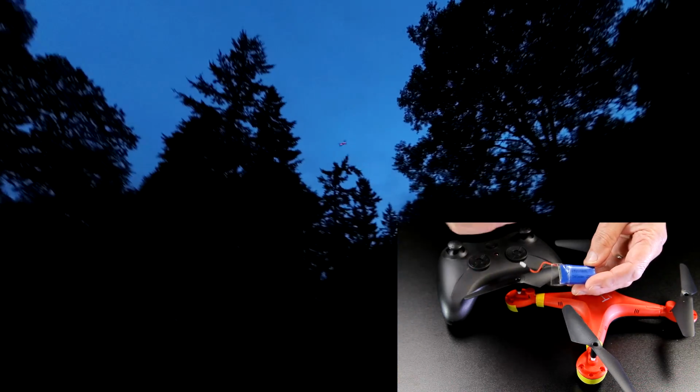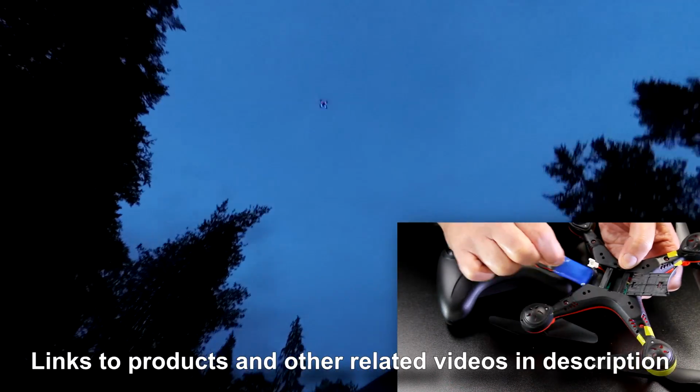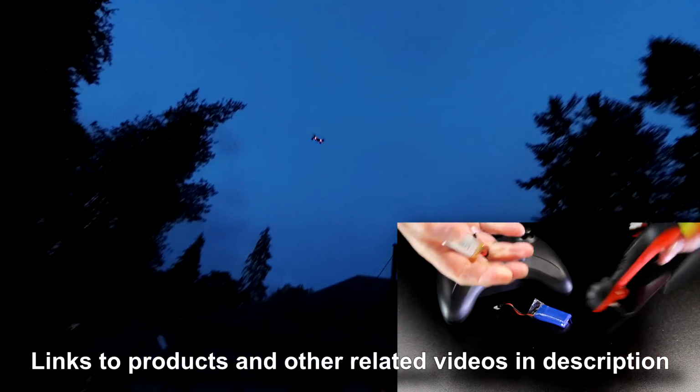So to me, I think that was brilliant. And you can buy other quads that these batteries will fit as well. Another little tip is just put a little bit of tape around there. I mean, sellotape, whatever you like, around something nice and thin, and then when it's actually in the battery bay, I'll just show you. When it's in the battery bay and you go to get it out, what you normally do is everyone winds up pulling on these cables, and that won't do your battery any good, and they will eventually come out. So with a little bit of tape in there, you can just pull it out, no trouble at all. So there we go.